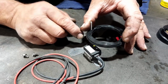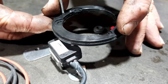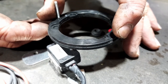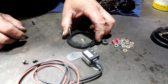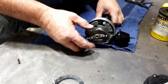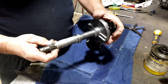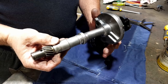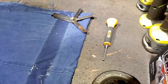So basically, by having that going up and down like that, that's obviously exaggerated, that's pretty much what you're eliminating or reducing by adding extra shims. So we're not missing signals or anything? Correct. It's a more consistent signal, yes. So we'll drive this in, double check our spacing. To check that spacing, other than those shims, we just use the good old feeler gauges.